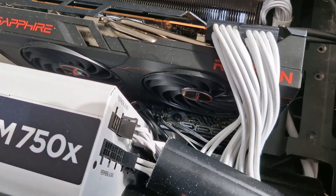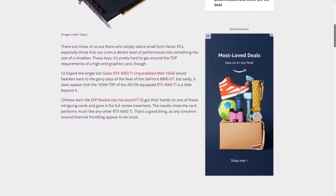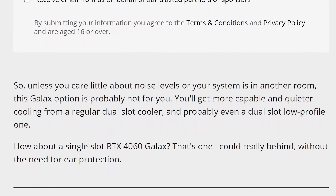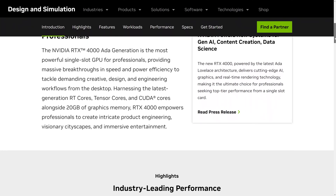The fifth possible fix, also not ideal, is to change your graphics card. I strongly considered this before buying a riser cable, working out that a 2.0 slot GPU would probably let me just squeeze my network card in. But really, single-slot GPUs are much better because you don't have to worry about installing at a tight angle or placing undue stress on the PCIe slot. Galax have a single-slot RTX 4060 card, which is pretty awesome since most single-slot GPUs are budget low-powered cards. The main downside is it runs really loud because the heatsink and fans are ultra-compact. Alternatively, Nvidia's workstation GPUs like the RTX A2000 or RTX 4000 ADA are single-slot, but they're designed for professional workloads, so gaming performance won't be great despite the high cost.